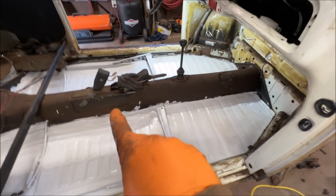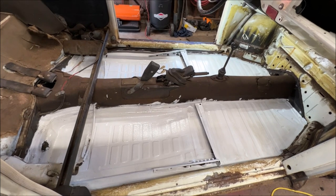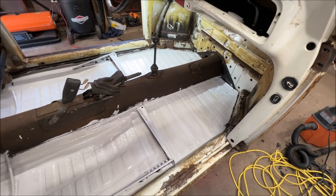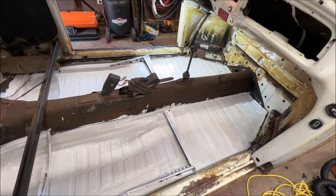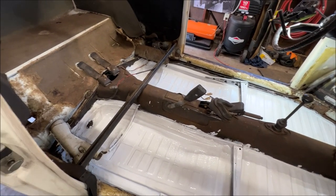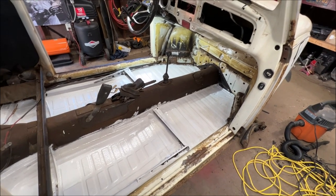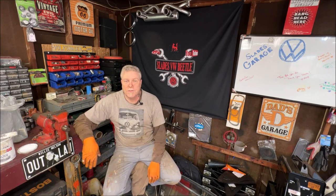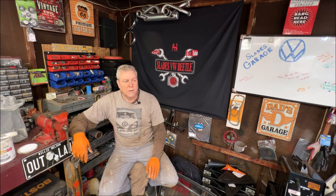Once this dries tomorrow, I'm going to hit it with some black paint - the oil-based Rust-Oleum. Then I'll be putting the sound deadener down. I'll film doing the black paint in the next video and edit it right in so you guys don't have to get bored. So that's it for this week. Thankfully my floor pans are very nice - I found one little tiny hole on the lip on the side, on the outside. I'll go ahead and wire wheel, clean it up, and weld a little metal patch there.